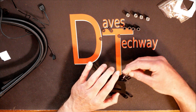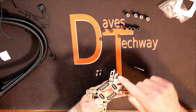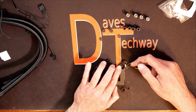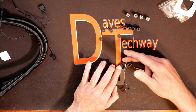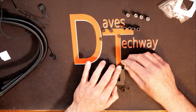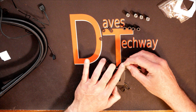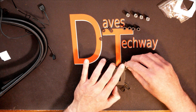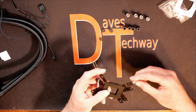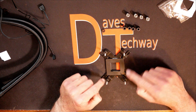For the AM4 socket, we need to take these screws and put them in the elongated holes. For AM4, you need them down closest to the Intel points. If you're using AM3, AM2, FM2, or whatever, you need to move them up to the top point. For the AM4 socket, keep them close to this Intel bracket. They do give you these little washers to push down to kind of hold these in spot — they fit pretty tightly. Just do all four of them the exact same way — that's what holds the post in place on the back plate.